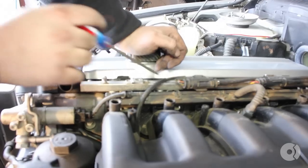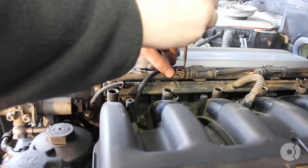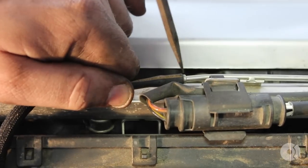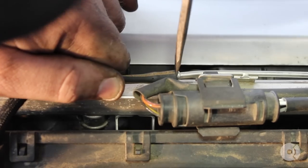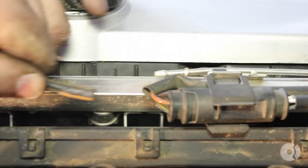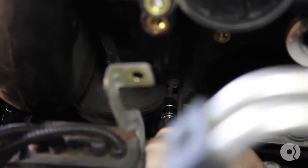There's one other vacuum line for the PCV. I'm replacing this whole line — it sits up here on top of the fuel rail. You can use a screwdriver to help slide it off, but the original vacuum line is going to be a little tough. There are two T20 Torx screws — one here next to the throttle body opening and one up here. So I'll go ahead and start removing the PCV.